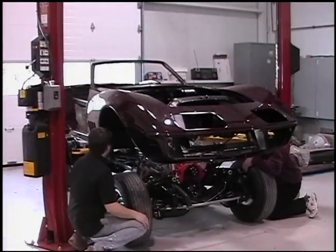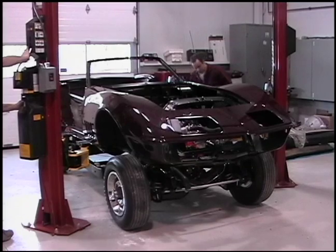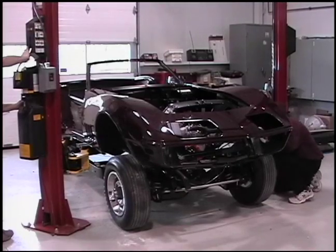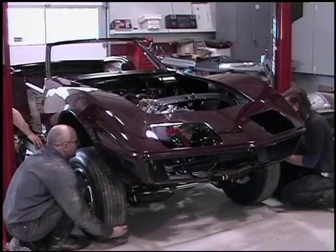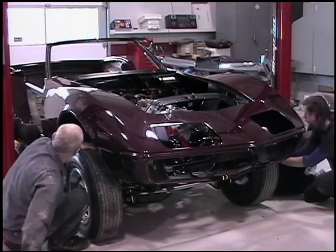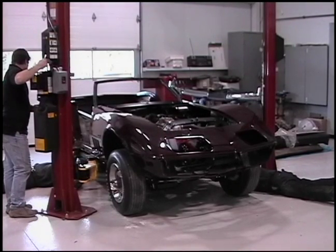There are a few tricks. Make sure that the center line of the frame is in line with the center of the body. As it comes down, you want the rockers of the body to go over top of the frame nice and clean, so you don't want it scraping the sides of the frame. The other thing you want to make sure is that the wheels are centered in the wheel well. There are lots of areas for problems to happen. As the body drops down over top of the engine, it can scrape that whole firewall if you don't have it centered just right. So spend a little bit of time, get a bunch of buddies so you have people in all sorts of locations looking for areas that are scraping on each other.